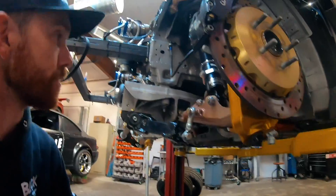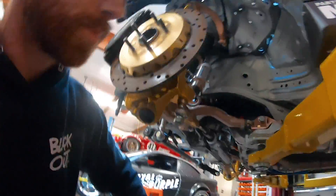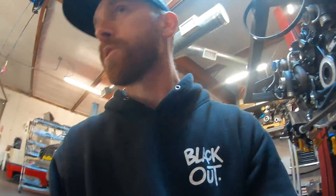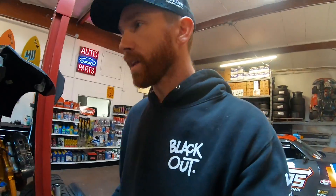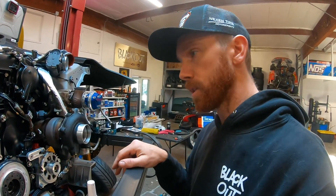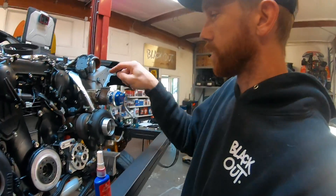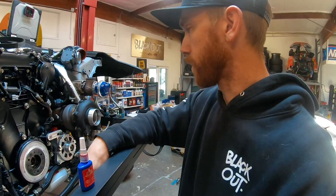Like I said, I showed you a couple different ways, a couple different wires — welding cable if you're trying to do it on a little bit more of a budget, but it works perfectly fine. I've used it for years on many different applications. The mil spec stuff is really nice, especially if you have the extra budget, because it's more tightly wound. So you're able to use a thinner gauge and get the same current — as say a two gauge, you can get out of a four gauge on one of those mil spec wires.